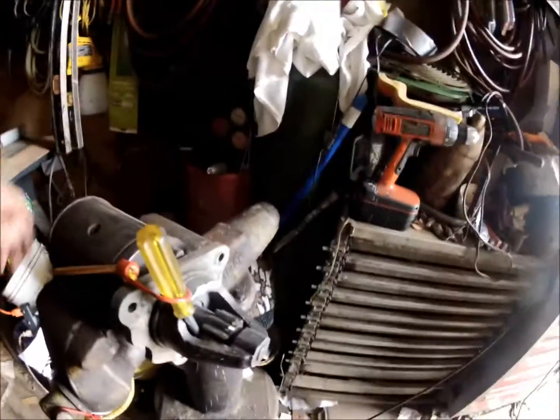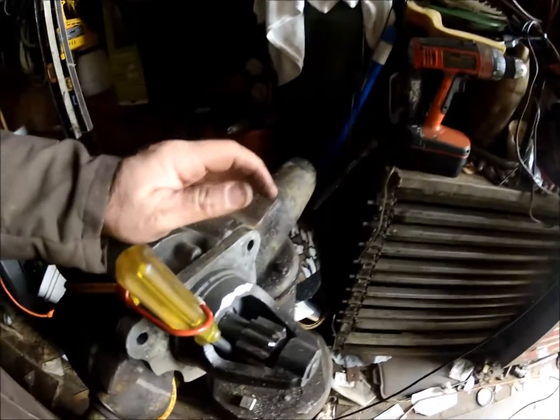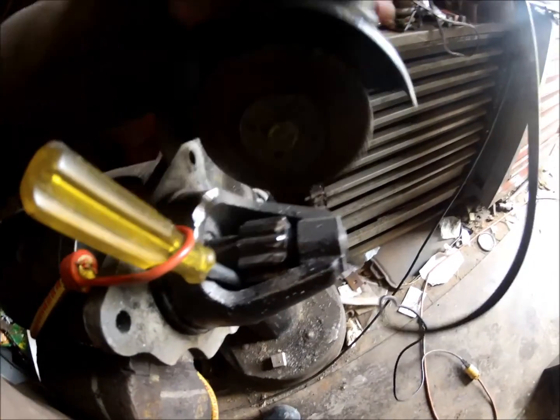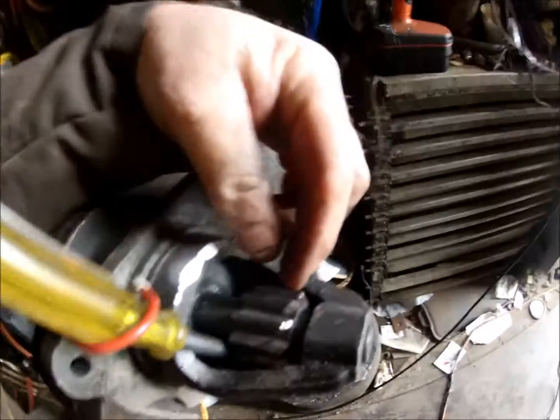Okay, I've spent the last couple minutes grinding on this Bendix gear, and I think I got it close enough that it should work. Taking the grinder, positioning it like this, grinding a taper this way, and then using the back side of the disc and grinding a taper this way in order to put a point back on those teeth right there.